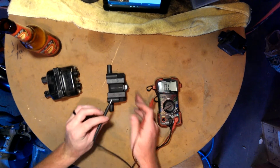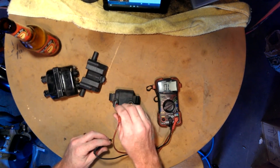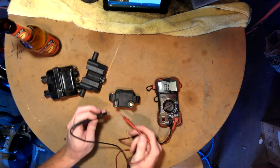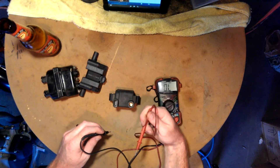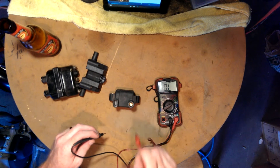The XB coil. Now, the Blast coil gets power in the middle — 12 volts. Ground on that side, and signal on this side. 12 volts in the middle, ground on that side, and then on this side the ignition tells it to spark, and it sends a spark through the spark plug wire.